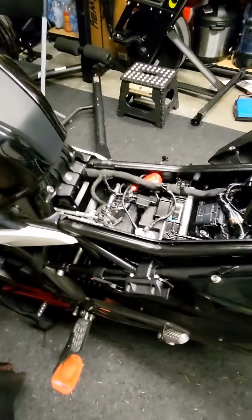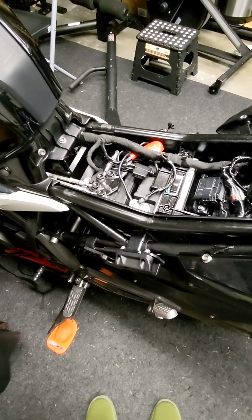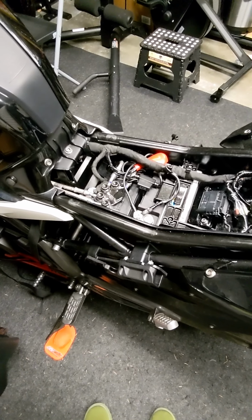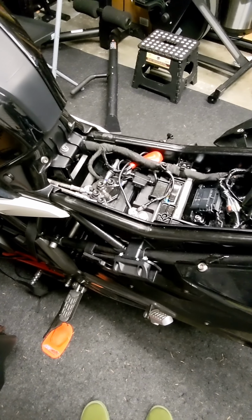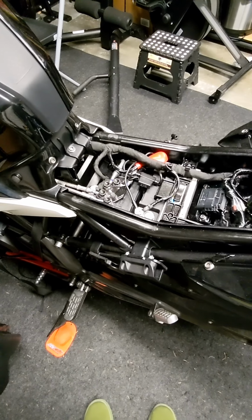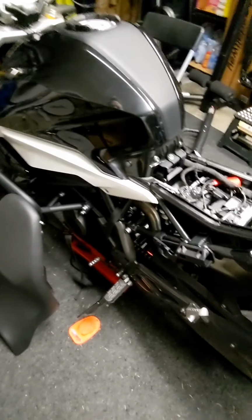Now, it's not necessary that you plug it in every single day. The bike could sit for days, weeks. Some fellows report their bikes sitting for months and not having an issue. But with the smart chargers that know how to turn themselves off and on and maintain the battery properly, there's just no downside to keeping yourself plugged in most of the time.